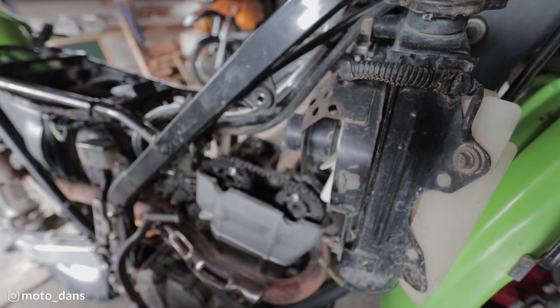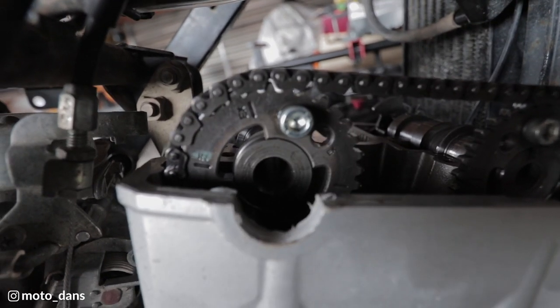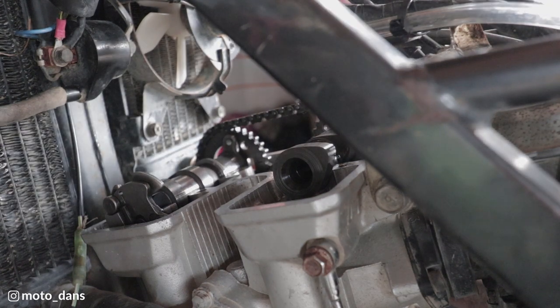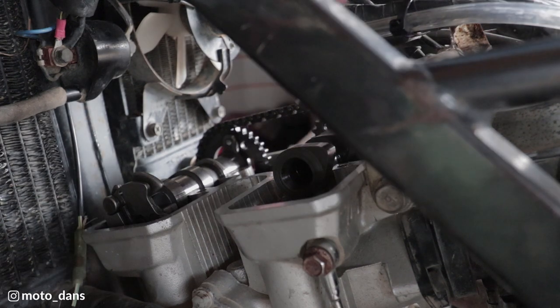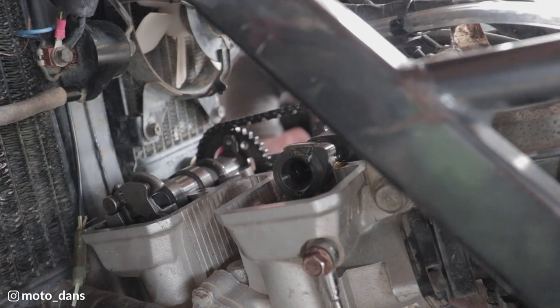My two marks have lined up there - I did a black marker pen on that intake there and then the same on the exhaust, so they're lined up, so that should be re-timed. With that timed up we can stick on our cam holder. This is just some engine oil - I'm just putting it over the bearing surfaces and pretty much going over everything on the camshaft.